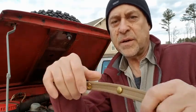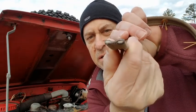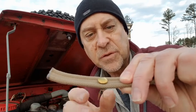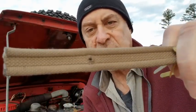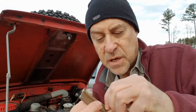So I ordered another bonnet rest strip which is thinner — you can see the profile here, it's a little thinner. I tried the original rivets with it and they still didn't work — they just wouldn't go through. So I got these brass clips — brads actually is what they're called — and they even come with brass washers. You can see the hole here, which is what I actually tried to use with the original clips. The clips just didn't come all the way through and certainly wouldn't go through the metal — they just wouldn't make it.